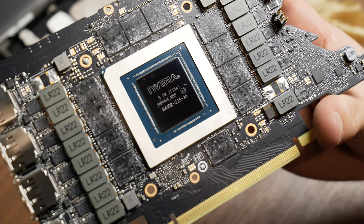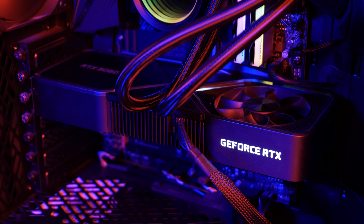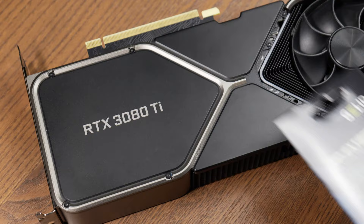The reason for this is the memory on my 3080 Ti. While the GDDR6X is very impressive when it comes to performance, out of the box it has a tendency to get very hot — damn hot. During long gaming sessions, I have seen memory junction temps rise to a sweltering maximum of 110 degrees Celsius.